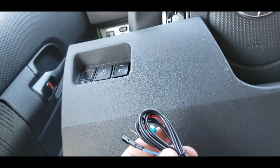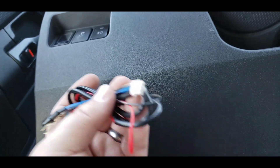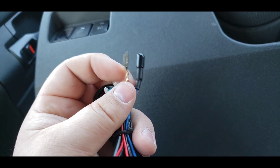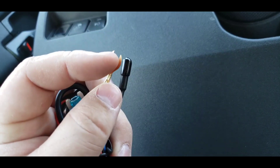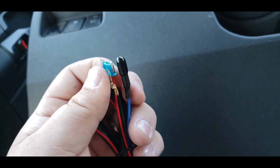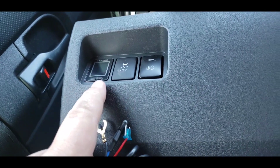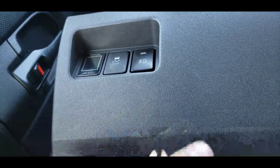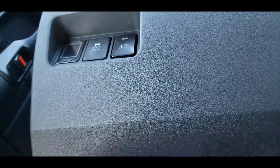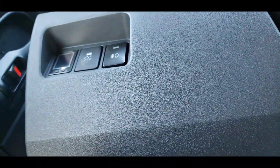You might ask how we're going to wire it — super easy. This is the wire loom that comes with it. You have a little white plug that goes into the screen, a ground that just slides over a nut and bolt, and then the power wire goes into the fuse box with the appropriate fuse. Everything else is done through the screen's menus and programming. The sensors are already linked together, so you just assign which sensor goes to which side and configure settings like Fahrenheit or Celsius, bar or PSI.